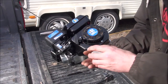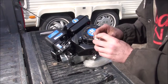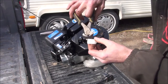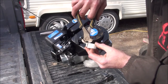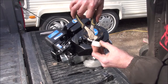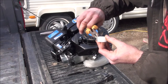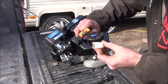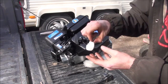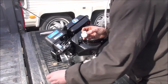So what I do is take your dollar store nippers and take that little guy right off. The closer you can get it the better. The factory put it right in the molding so it looks like it's supposed to be there, but when you think about it, that little block keeps the float from coming down and letting fuel in as fast as it could — or as it should. So take that little block off there.